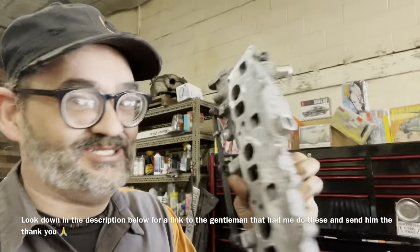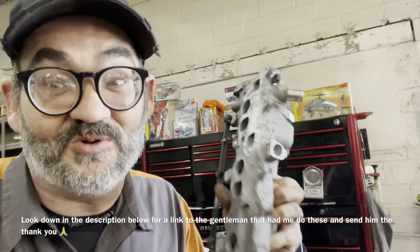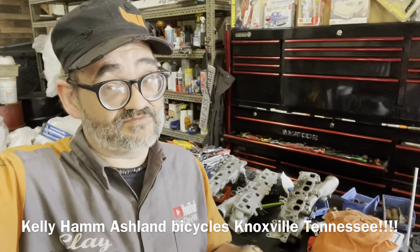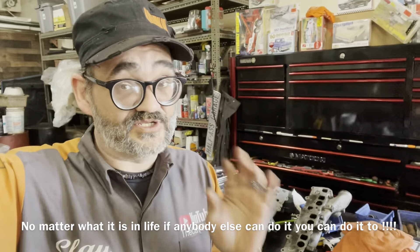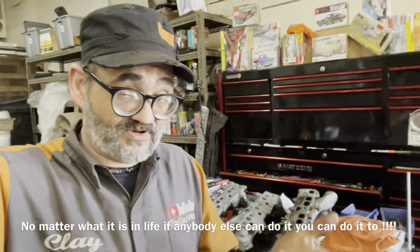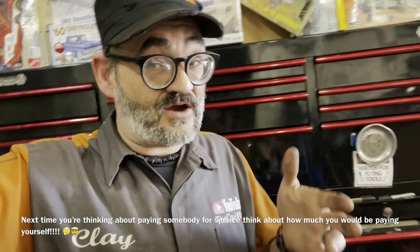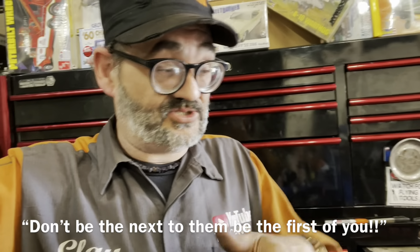I'm super excited today. I deleted these and made them work with the sensors - this is some crazy stuff. Hey folks, my name is Clay with the Clayway here in Grand Rapids and Muskegon, Michigan. If you know me or you've seen my show, I show you brilliant things you can do with Sprinter vans, like how to install a resistor to bypass the swirl flaps temporarily - because you still have EGR gases going through the intakes, which isn't good, and the carbon creates other issues you're not seeing.